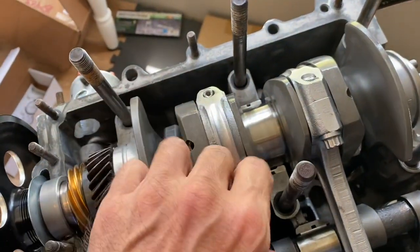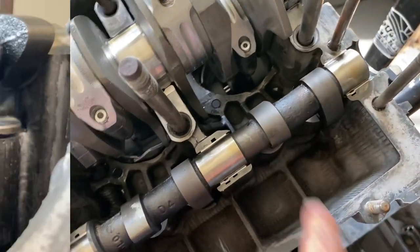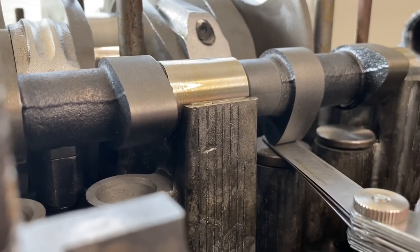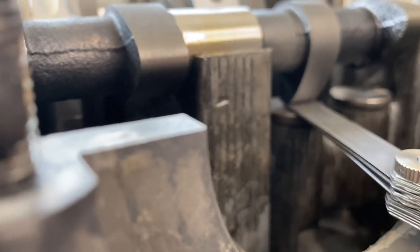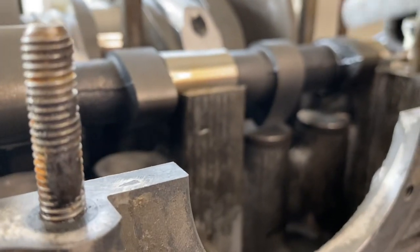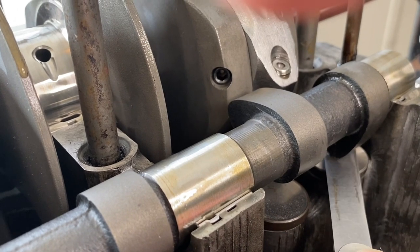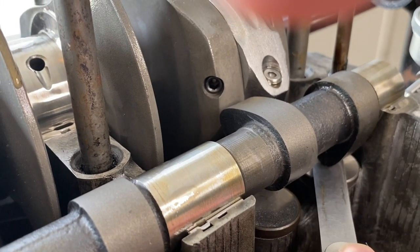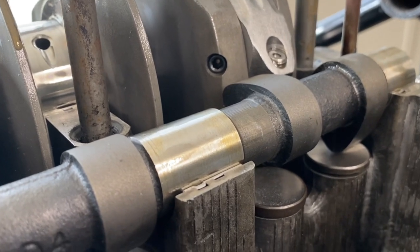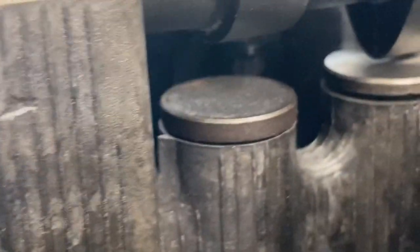I'll verify by the pulley when we turn it — see the rotor cap is turning, so I'm going to go with that. Now I'll move on and talk about the lifters. The thing I'm looking at here is the cam lobe to lifter clearance. Using the gauges, I've got 0.050" under there. I'll check the next one — and that one is 0.050" also. From what I gather, that's a pretty good cam lobe to lifter clearance.